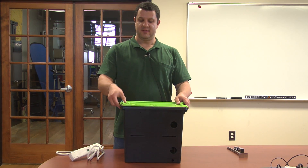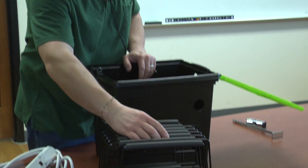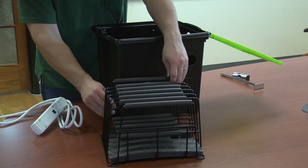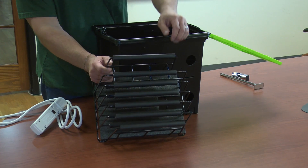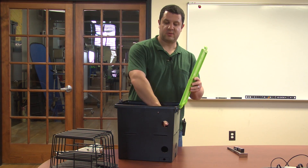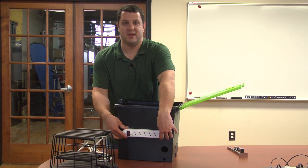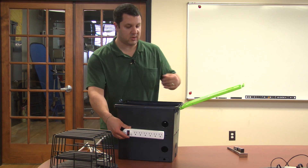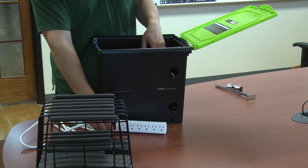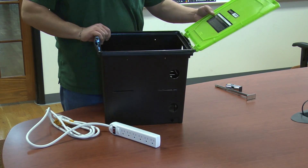Let's walk around the TechTub a little bit. Opening up the lid — I mentioned this one was for Chromebooks. Inside the TechTub is this rack. This particular model is made for five Chromebooks going right in here, and there's space over here for the power bricks — you'll just slide them in there. You'll notice some holes in the TechTub; this is for your power cords to go through. Your power cords would come out, and you'd actually get the included power strip and bolt it right to the side of the TechTub. On this model the power strip is on the outside and can go on either side. When it's fully wired up, you'll have power cords coming out here, plugged into the power strip, then running inside into the rack and into the Chromebook. Then you close the lid and secure it.